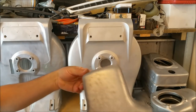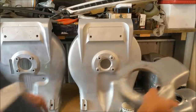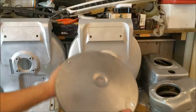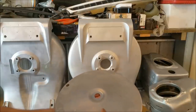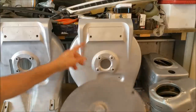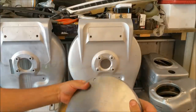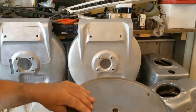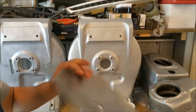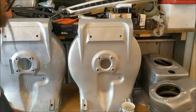Yeah. And then there's this one as well, which is another 125, I'm quite sure. The cutting discs, again, hydroblasted. The reason for that is I want to have a good look at them to make sure there are no cracks. I found one with cracks, no good. That goes straight in the bin. This is off this machine from the rubbish pile as well. It still has all its Victa markings and part numbers. It's in outstanding condition. These will just get a rattle can silver coat in enamel just to stop them corroding.